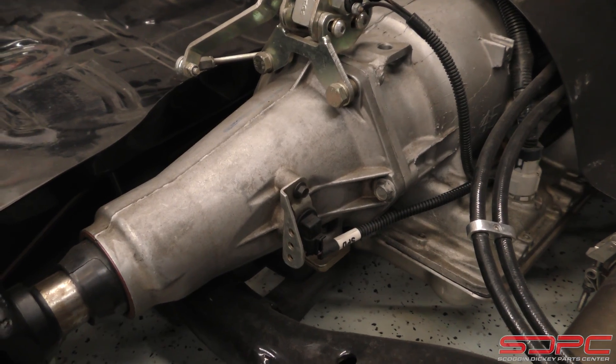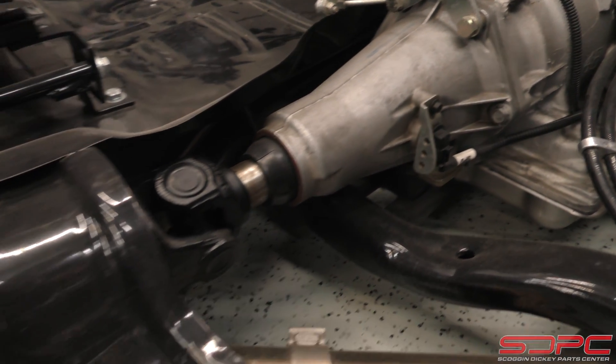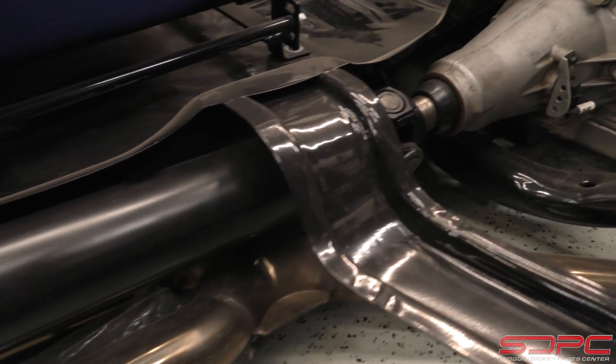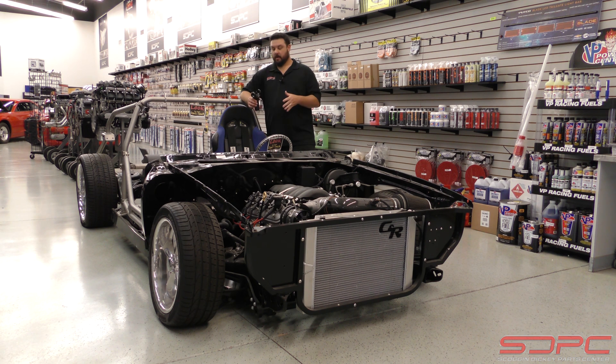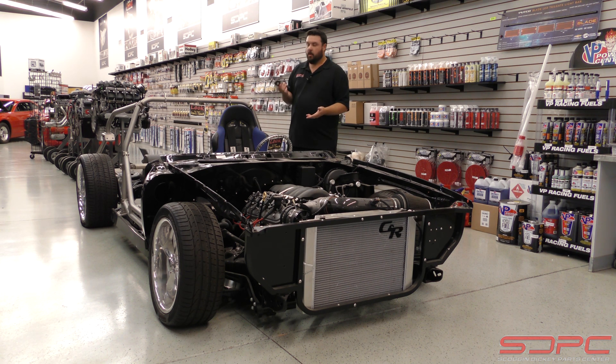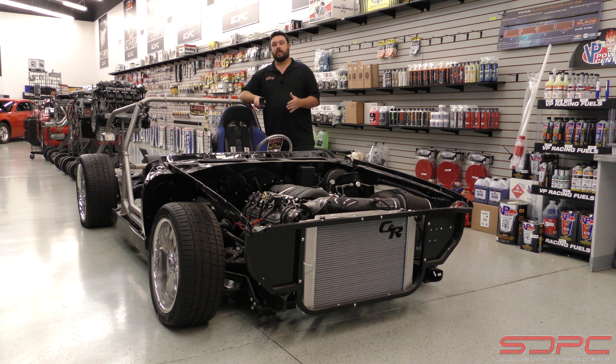Everybody calls and asks about this. Now, eventually GM does have to stop somewhere. They can't keep going until the axle, and then before you know it they're selling you a whole new 69 Chevelle, even though I really wish they still would. So a lot of y'all ask, what do I do once I get this engine and transmission mounted in my car? Where do I go for something like this? What you need to do is usually contact a local drive line shop that can customize you a drive shaft.